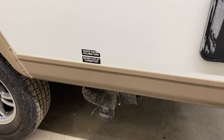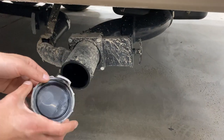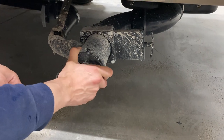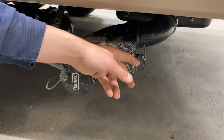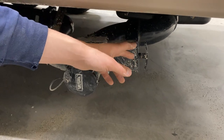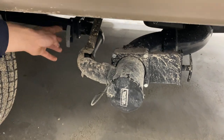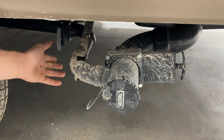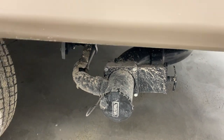One step forward and you've got your sewer system. Press that cap in, give it a little turn, and pop it off — it has the exact same ears as your sewer hose, so it attaches the same way: press it in, turn it, and it locks into place. On the right you get a black valve controlling your black tank, which is filled from your toilet — that's your dirtiest water, so you'll dump that first. On the left is the gray valve controlling the gray tank, filled from your sinks and shower. Dump that last to help flush things through, as it's typically cleaner water.